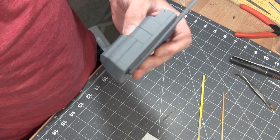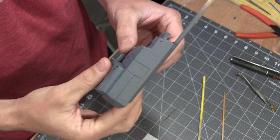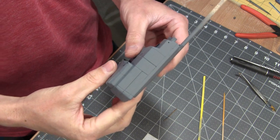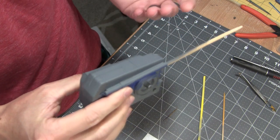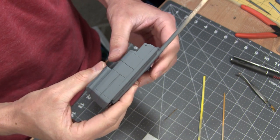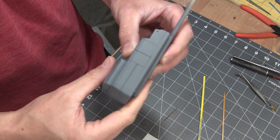All right, so now it's time to get started on the body work, getting it ready for paint. So I have a primer coat on the body, but this isn't the primer coat for the paint coat. This is the primer coat for doing the body work. And the reason I like to do this, and I would imagine other people do this too, is because the primer coat allows you to see little defects in the body work that you've done.